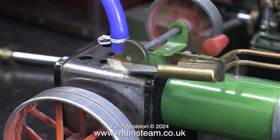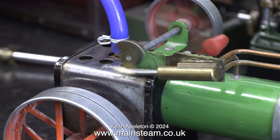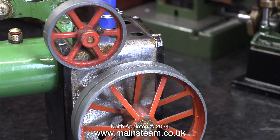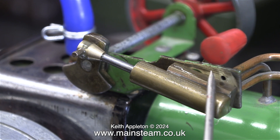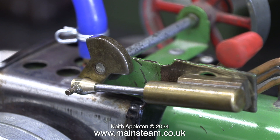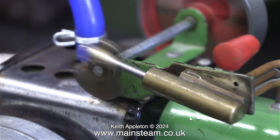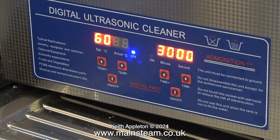When in doubt, leave it out. This clip is of course running in slow motion. Once the newly lapped cylinder and port face run in — or bed in, or break in, whatever you want to call it — it should run better. This is another clip showing how dirty the engine is, just so you can compare with later on in the video. The port face looks a lot shinier after very little running. I did not clean the parts before I reassembled them, so some of the grit from the sandpaper actually helped to lap both parts together perfectly.